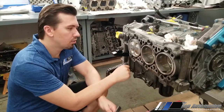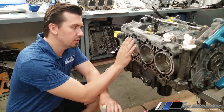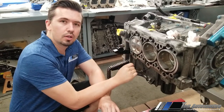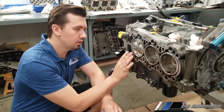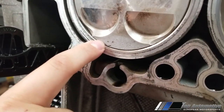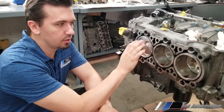We're going to use this depth micrometer to measure the head clearance and spacings here between the head and the piston. We're going to measure from each side, measure the rock, and determine what our clearances are. If you come close here, you can actually see contact marks on the piston — and the same thing goes on the heads.